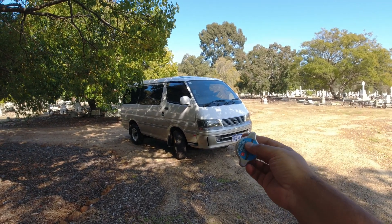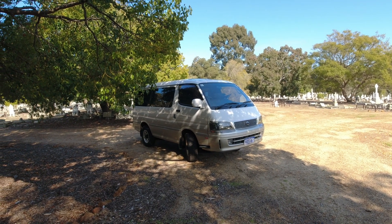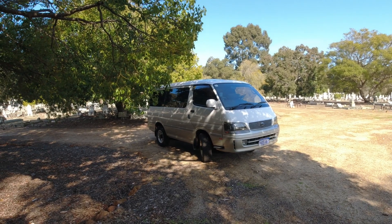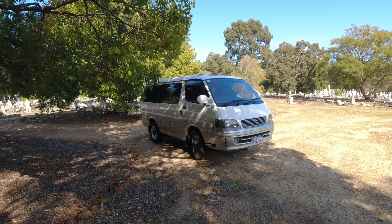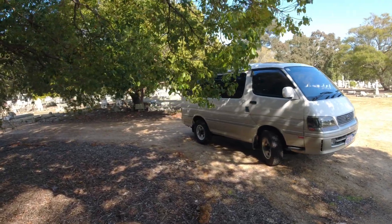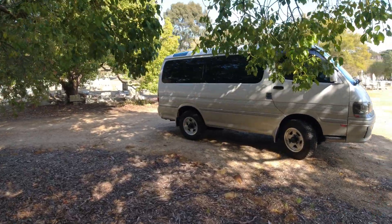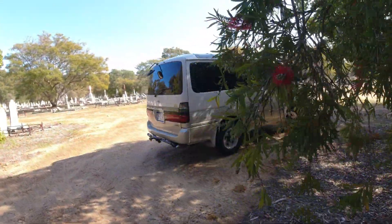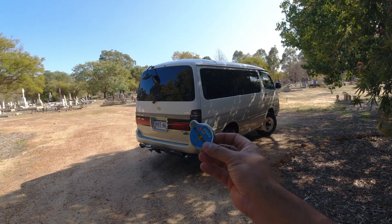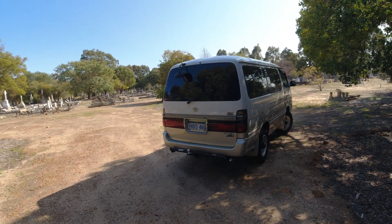I went fishing in my toolbox because I knew I had a few radiator caps from old Land Cruisers, and I replaced the radiators but kept the old caps because they were in good shape. I put a 15.7 PSI radiator cap into this thing, which is the right PSI for it, and it was fine for a couple of months until it started losing coolant again. I began to suspect the radiator cap was faulty, so I put the original one back on — and sure enough, the coolant stopped disappearing. It was obviously the radiator cap.